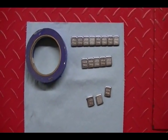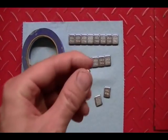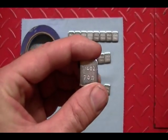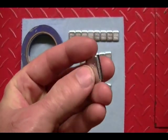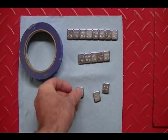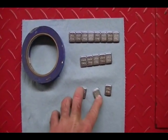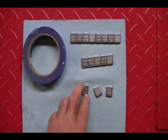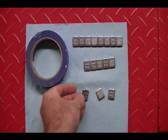These are the weights I'll be using. They come in strips of eight and each square is a quarter of an ounce. On the other side there's an adhesive backing used to stick the weights to the rim. I'm going to be using painters tape to apply the weights to the rim until I determine exactly how much I need for a particular spot, then I'll use the backing on the other side to stick them to the rim.